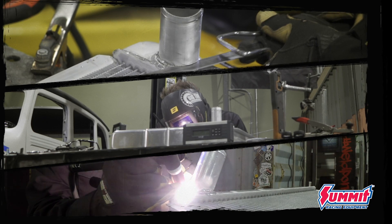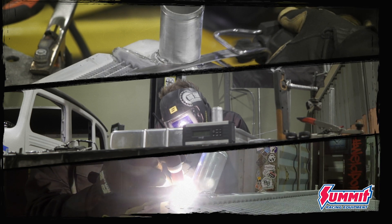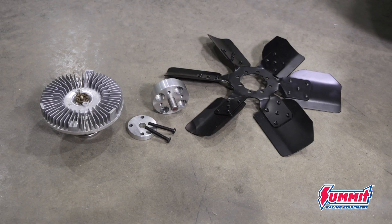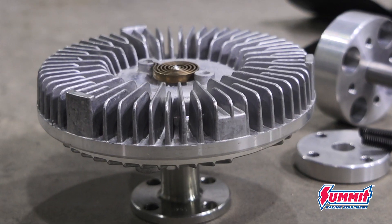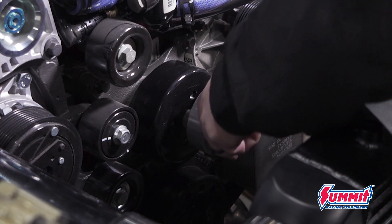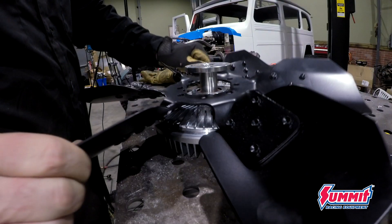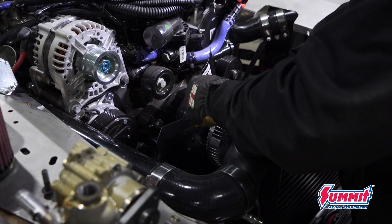While I've got my Rebel AC-DC doing work, this is a good time to make the required changes to my radiator. I know that the lower tube is going to have to be clocked differently, so I'm just gonna take care of that now. The reason I have to move that tube is because I plan to run a mechanical fan on the front of my 2.8. The Cummins R2.8 runs incredibly cool, and I just don't want the hassle of having an electric fan on the front of this truck when it's hardly ever going to be working. Quickdraw brand makes a simple kit that will adapt a standard thermostatically controlled clutch fan to the front of this engine. One less thing to worry about, and it just looks right having a mechanical fan on the front of a 53 Willys wagon.